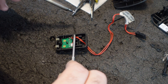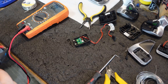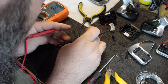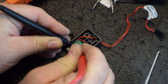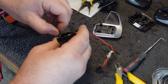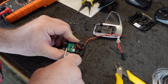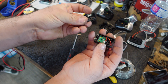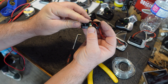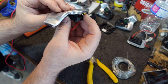Once it's all cured and cooled, use a pick to give it a couple of pokes to make sure it's a solid connection. With a multimeter, check continuity between the soldered connection — one will be a positive track and one will be a negative track. When you depress the paddles it will end up grounding on these two gold rings to the left side. You're going to ground the top upper wire, and once done just reassemble it as it came apart. When you click the shell back in, make sure the spring is where it needs to be. There's sometimes a little locating nub to help you close it — put the two hooks on one side, clip it together, ensure it's clicking appropriately, and then put the slide pin back into place.